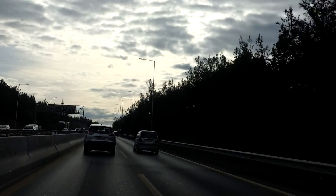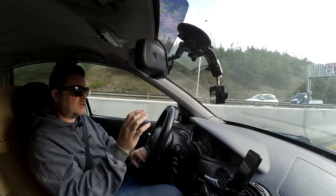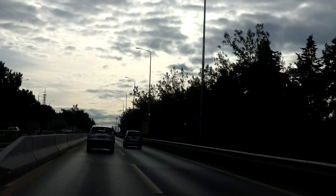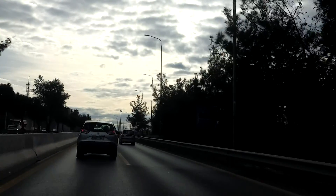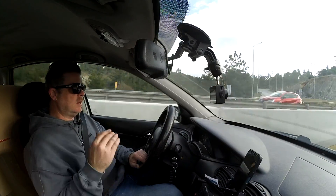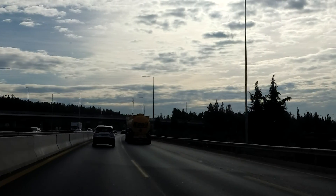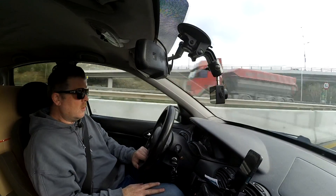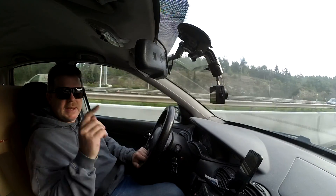So if I can pack all that back into a nice neat summary: before you start tuning or adjusting your BOV, you have to make sure all the hoses in the BOV system - the vacuum hoses - are in A1 condition. It's pointless making adjustments if the foundations are not good. What we're going for is to run the softest possible springs. That's it guys - that is the video. Hopefully you found it informative and it helps you if you want to adjust the blow-off valve on your car. As always, look after yourself, please vote on the video, subscribe to the channel, and I'll see you in next week's video.